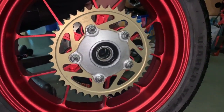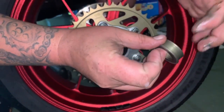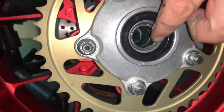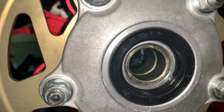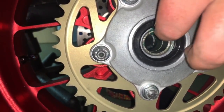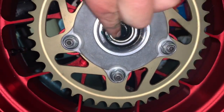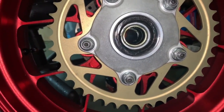So now it's time to do our outer spacer, which is the fatter one of the two that came out on this side. And just like before, this one has a little lip, so it kind of locks into the rubber seal. But what these spacers actually do is, in here you can kind of see there's a little channel around the seal that when you pack it with grease, and when you put the grease on the axle and put it in here, it actually causes the grease to kind of re-lubricate itself, if you will. So we always put a nice dab of grease in here. We're gonna put more on the axle, but it's nice to just pack a little bit of grease on there for your spacers,